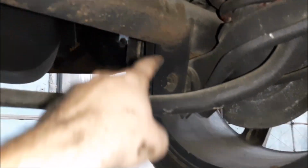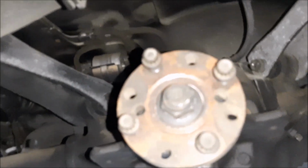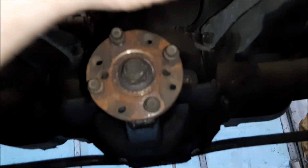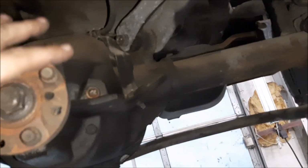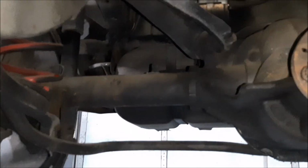All right guys, so while I'm underneath here, I went ahead and loosened that bolt up. That's the rear control arm. Did the other rear control arm. Top control arm, see, these are just finger tight, enough to just push it outside and get it where we need to be. And then I loosened up the bottom shocks where they mount, and I'm probably going to go ahead and just take off the quad shock on each side because those don't even need to be hooked up. So that way when we get it out in the yard, I'll lift the Mustang up, pull all those bolts out, drop the rear end out, get it out of there. And then this car, I don't know if we're going to put another junk rear end in it or what, but that's what we're doing.